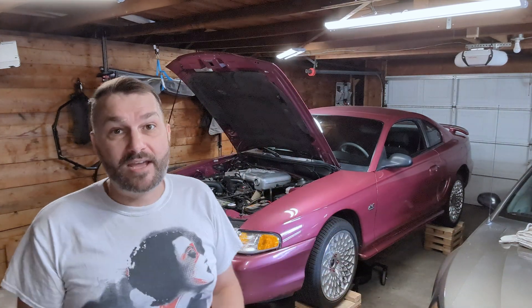In the case of this car right here, I was having a bunch of misfires and I was having a hard time figuring out exactly which cylinder was misfiring. I was really having a hard time mustering up the desire to take everything apart and troubleshoot the old-fashioned way. This made it a whole lot easier because all I had to do was start the car up, point it at the exhaust manifold, and I could see which cylinder was less hot than the others.